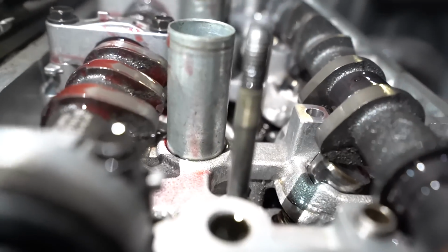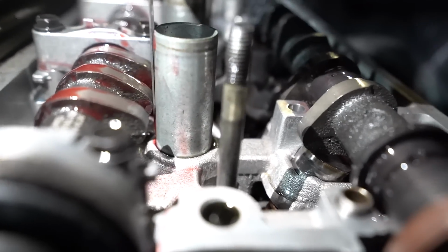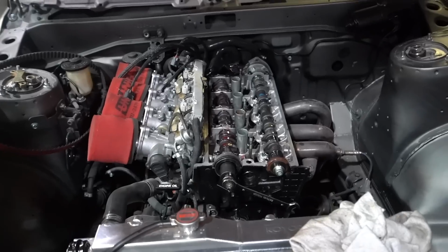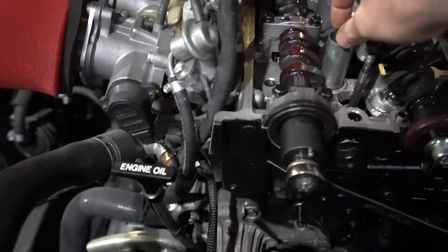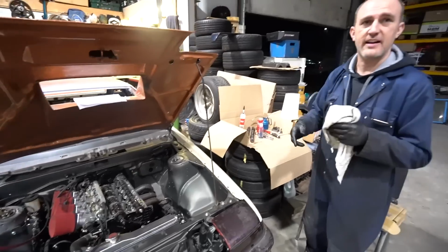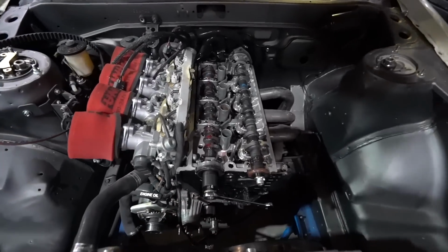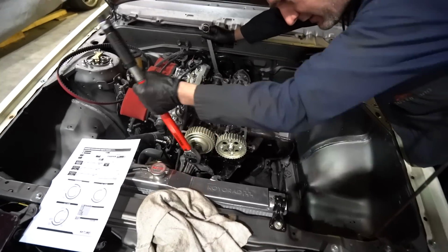Stick it in your lobe. 0.75. Oh, that's 0.85. So it's a 0.85 gap, maybe a little bigger than 85. That's why they don't exist past that tolerance, without modification. But same with the 16 valves. Like, you go over 9 mil, you have to machine the head so the lobes actually pass around. Same with Supra engines as well, like 2JZs won't fit unless you clearance them. And this would only be for back wheel drive, I'd say.